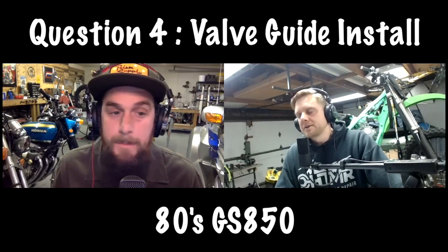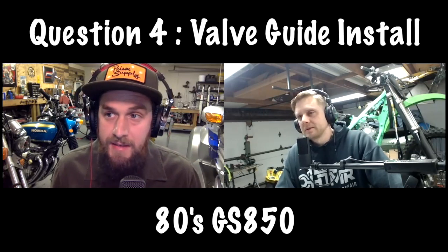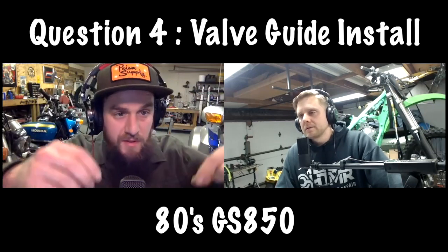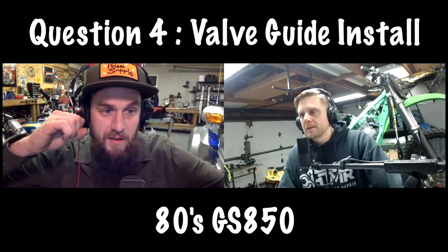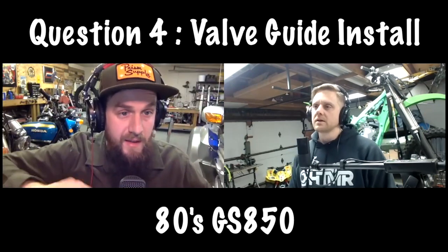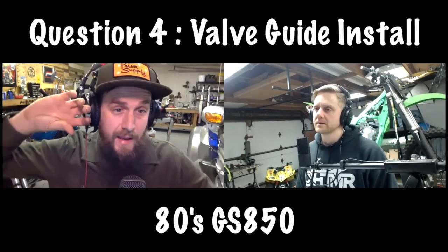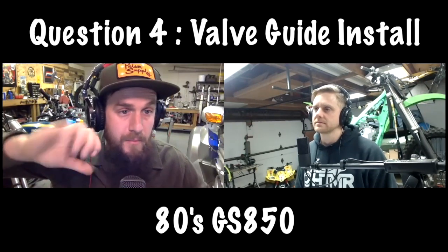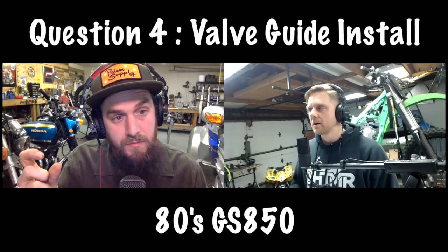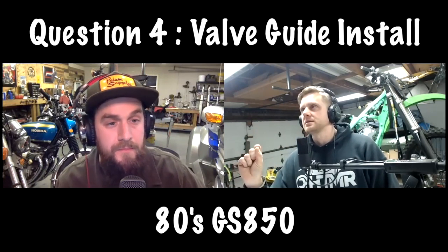I understand. Okay, I understand what you're saying. Yeah, I don't know what this tool is like. It's not like a bolt extractor looking thing. It's just like flutes on a straight rod. Okay, like chambers and flutes. So you've taken it and you're just spinning it in and cutting this new surface. Yeah. Almost like honing in a way, removing any burrs or any bad things in the guide. And then you're going to measure that. Okay. All right. I know what a reamer looks like, but I was, okay.